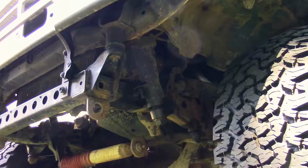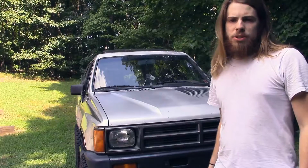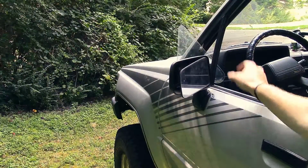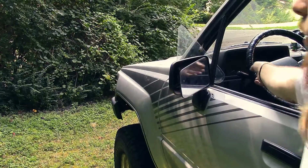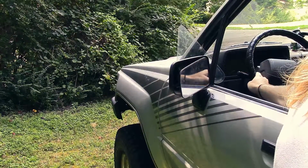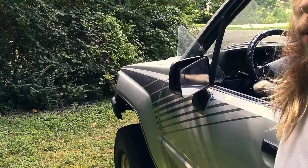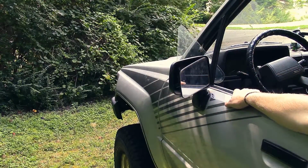I'm going to be doing a new steering gearbox, high pressure power steering line, idler arm, and Pitman arm. All right, so this is how much play is in the steering wheel. It's a lot of play, it's pretty unsafe, and it's never been replaced, so I'm going to be doing that